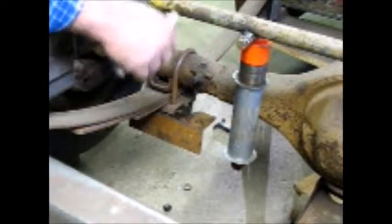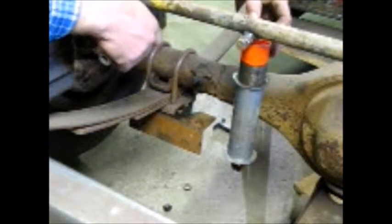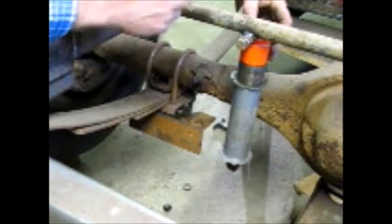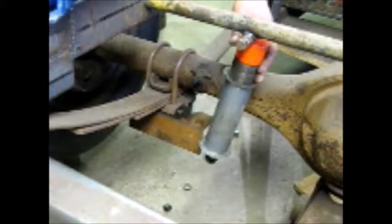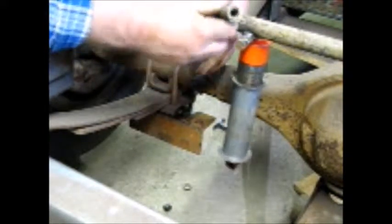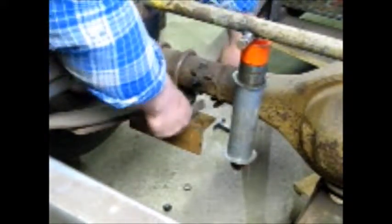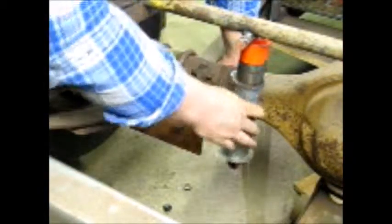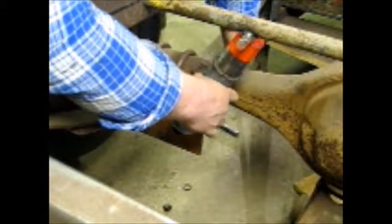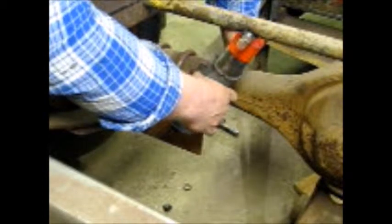That coilover actually pivots. There's a Heim bearing on the inside of the shock there. It pivots on that. That's going to mount back in there. I'm going to go ahead and take one of these right here and cut it down to size, and probably end up welding it on top of that. I got to cut that bracket down. This will come in. The bolt will go in there. That'll be that.